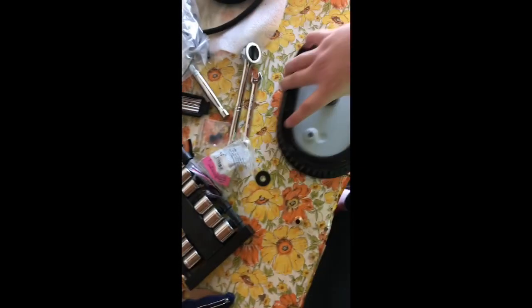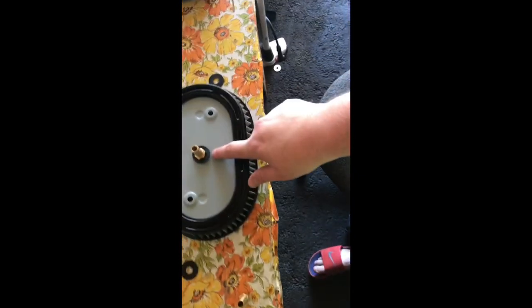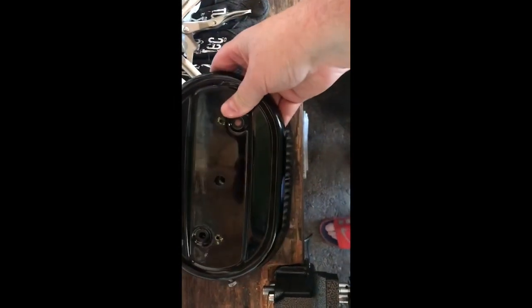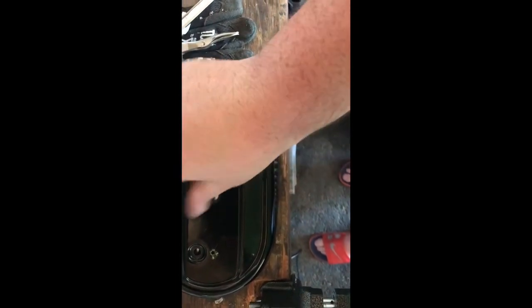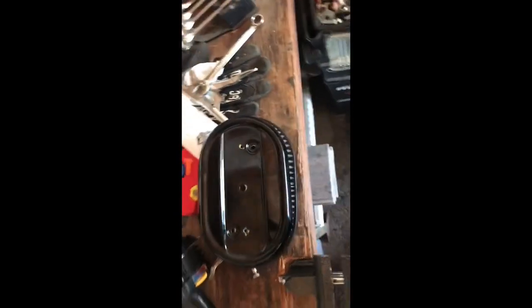Really the only thing is I want to use the K&N air filter, but I think this is going to be a pretty good thing, and I'm going to refine it with the K&N. I'm going to bring this to my buddy and say, hey, let's get this out. Because I used the male to female, the reason I bought a male to female and a female to male T's and barb is because this sits pretty flush with this cap. My thought process was the male end is going to stick out and it'll be enough to thread on, whereas this one is shallow. It doesn't have that little bump. So it works a little nicer in the sense that I can slide it off and on pretty easily, whereas if I did it with this, I'd be screwing off and on that barb. So that's kind of the deal.